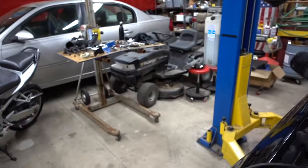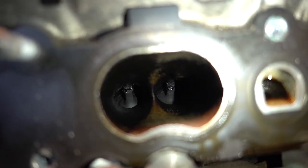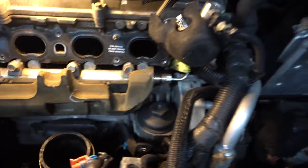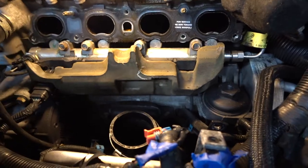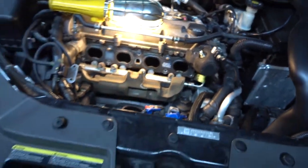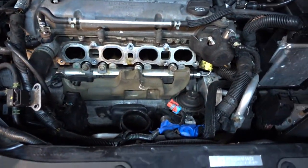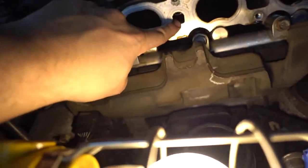As you can see the intake manifold is off — it's just sitting over there. That is how all of them look, and that's after about a hundred thousand miles. Needless to say it's in dire need of cleaning, and this is why you should do it. If you're doing what I'm doing and replacing it with the Powell PCV, you'll never have to do it again. And if you're like most people and don't think that spending 700-some dollars on an intake manifold is feasible, this is the PCV.